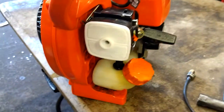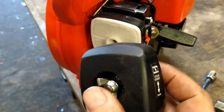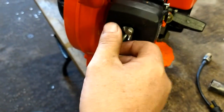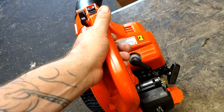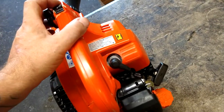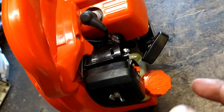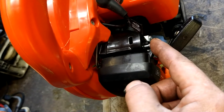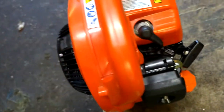New air filter on, then the air filter assembly — choke label towards the choke, thin side up, fat side down. Screw it in place. The only other thing: if it's revving a little too high at idle, turn this screw counterclockwise; if it's idling too low, turn it clockwise. You can adjust your idle right there.